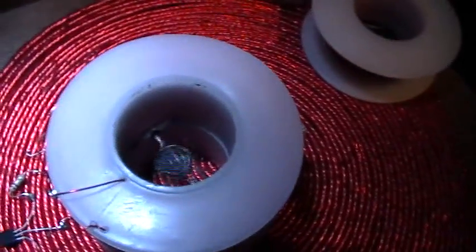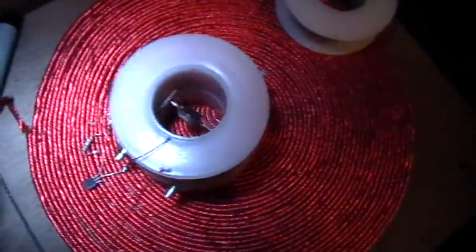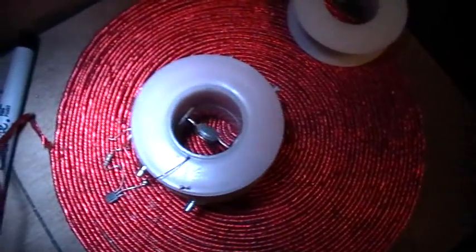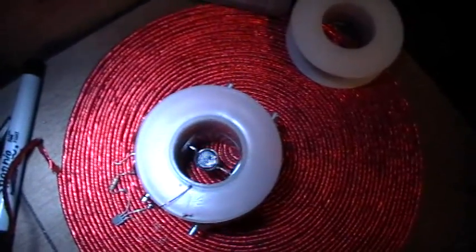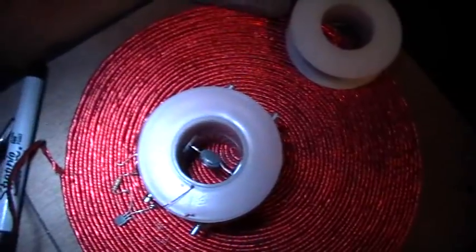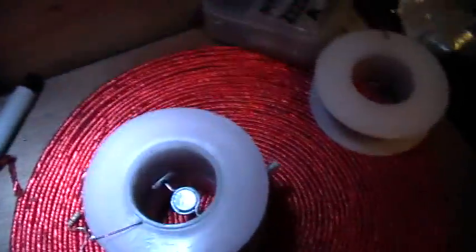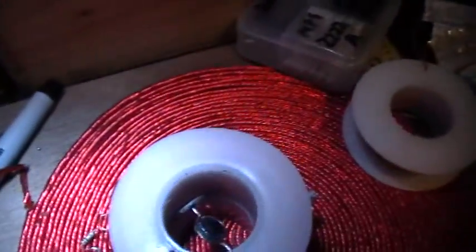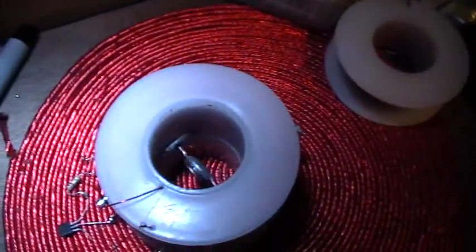As you can see, my suspension is not really fast. That's just under 200 Hz — 195 Hz. The strobe tach is indicating about 11,700. And 195 times 60 is 11,700 rpm, confirmed by the strobe tach.